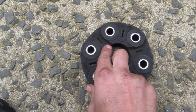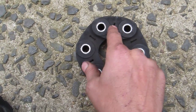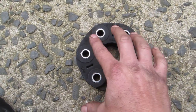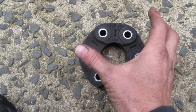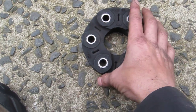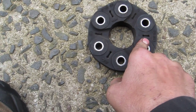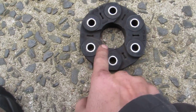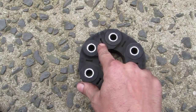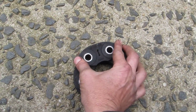You have a stretching going on — the rubber band effect. Now when the person lets in the clutch, all this unwinds and whack — you have your input shaft being tossed backwards. How you're supposed to do this is: engine here, output of your transmission here, and your driveline here. You push onto the meat of the disc — that little gap closes up, but now you're pushing on the full meat, so this doesn't compress as much.